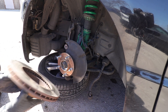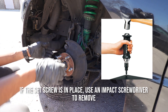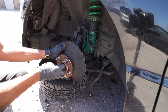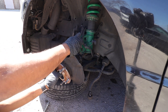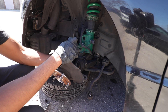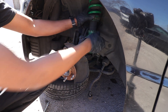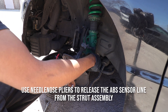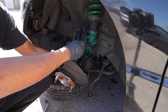I'm going to remove my rotor just because I don't have the set screw in it — I'll set this off on top of my wheel. The rest of this should just kind of come out. Let's take this nut off. Before I pull that out, I'm going to remove my ABS sensor from my strut just so it's out of the way. That gives a little more room to tug on things.